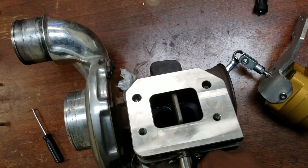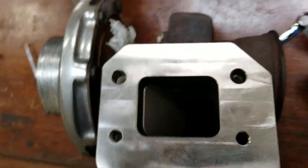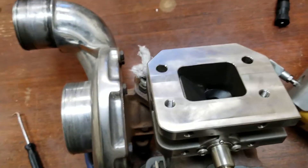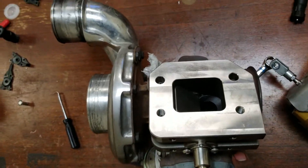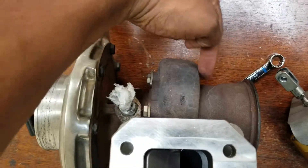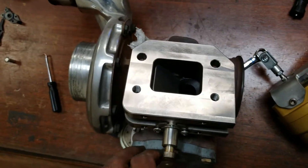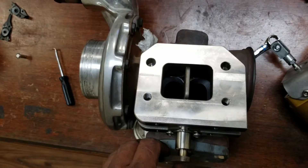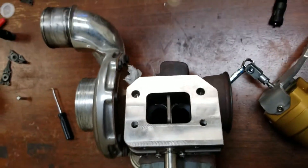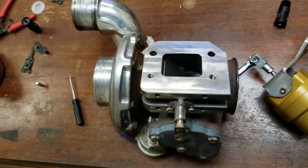What this little special valve does here is when you're not on the boost, that little valve right there closes up one of the volutes. You can see the little volutes in there. One of them closes up and all the gas goes to the small side of the turbine over here. As it does so, it spools you up while the truck is not under a full load. Then as you build about 14 PSI worth of boost, that little valve opens up and you get exhaust flow across both volutes. So you have all the benefits of fast spool up and nice high end performance.